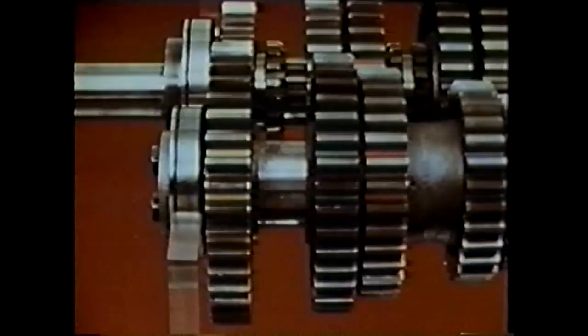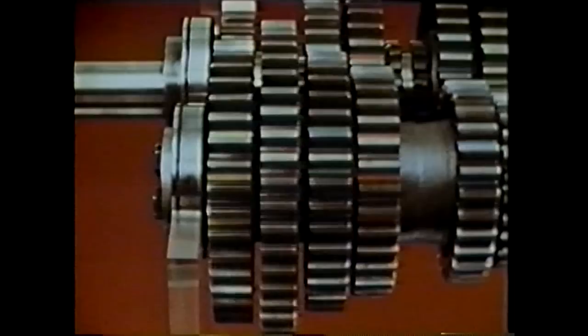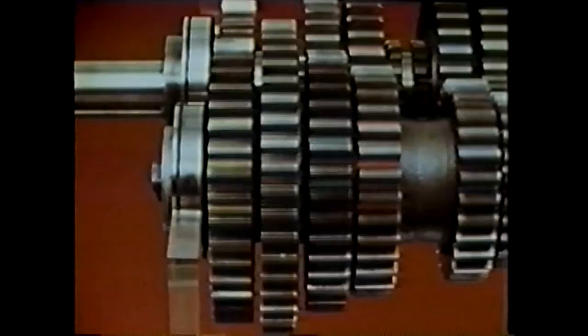Notice the gap between the gears on the counter shaft. We can add one more gear right there in that gap — the power takeoff gear. There is no matching gear on the main shaft, because this gear is keyed to the counter shaft and is always ready to provide takeoff power whenever the counter shaft is turning.